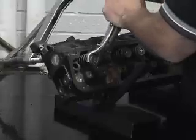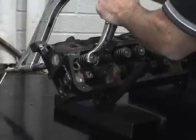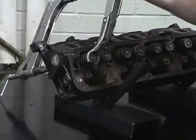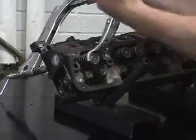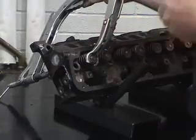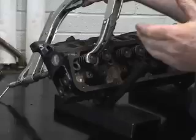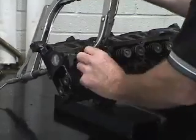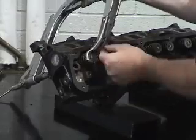We need to install this so it is loose with the clamping device closed. One of the biggest mistakes technicians make is they pick it up directly off the bench and then try to compress a valve at a smaller or larger dimension, giving them trouble in the disassembly or reassembly process. So I'm just going to re-correct my yoke now that I'm closer to the position and I already have the apparatus closed.